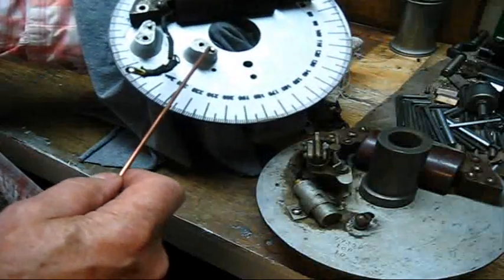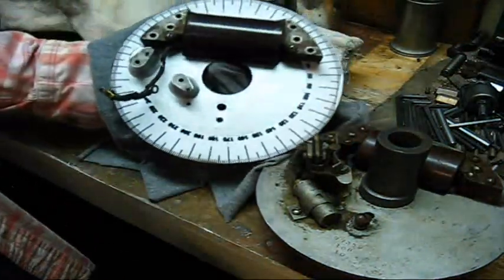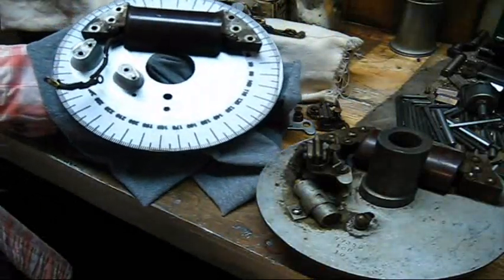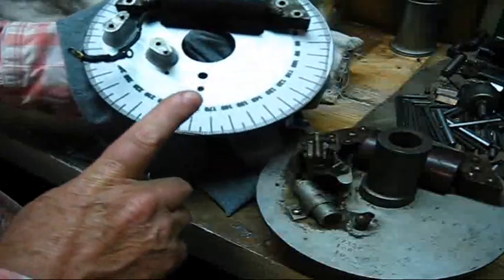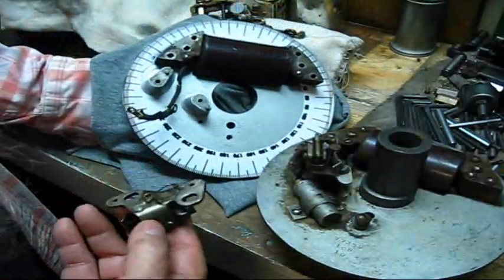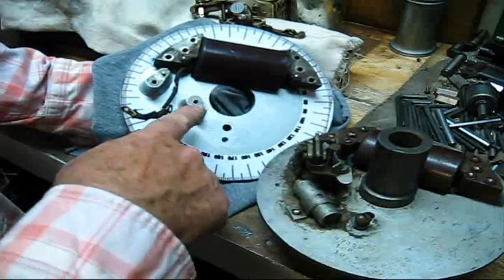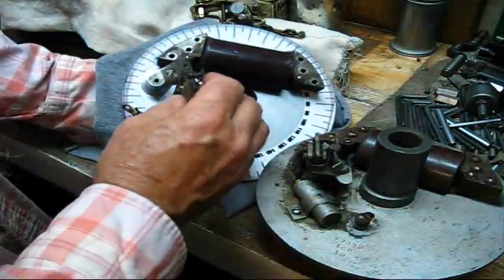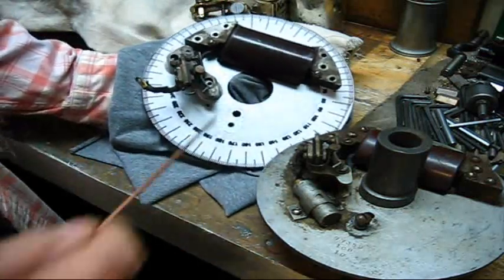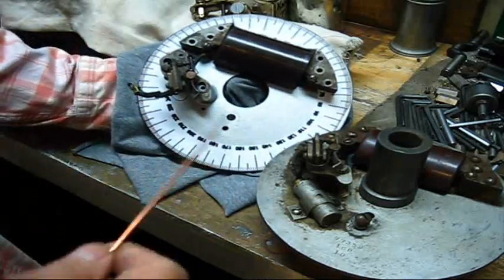They have the pins to position the points — it was fixed. You had no choice with this 1937, and it wasn't a good idea. On this backing plate here, you could only use one type of point set — the one that's got the two holes in it that would fit in those pins. You put that set of points on those pins right here and right here.